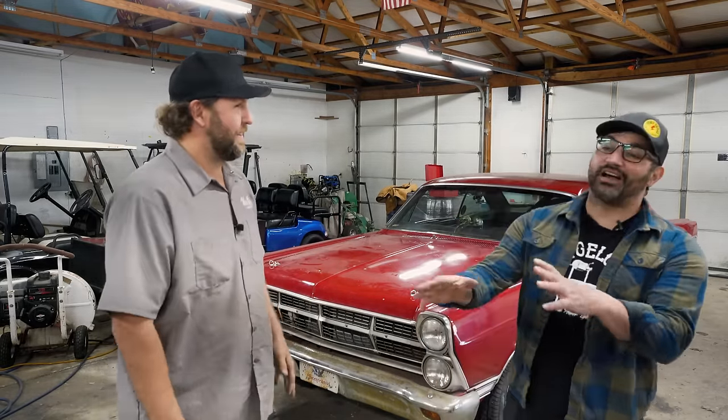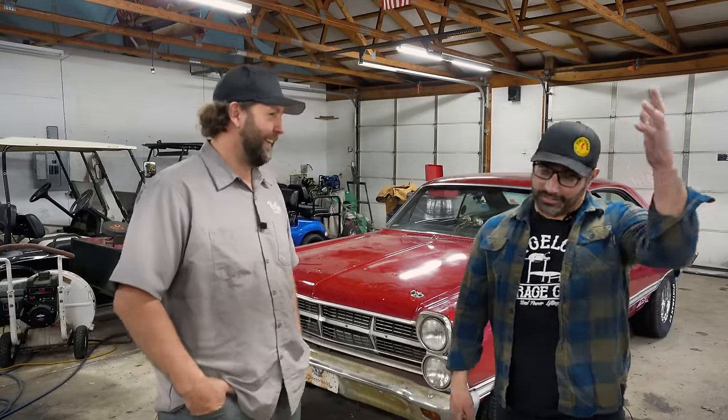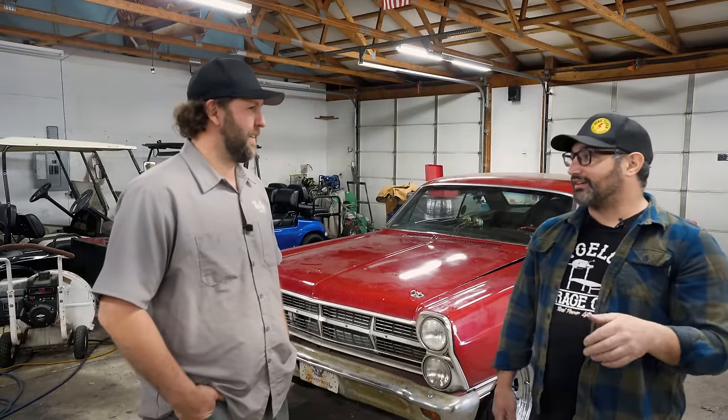Yeah, we tried to sneak it by as just a little stock motor we put a four barrel on top of, but we got a little bit more nasty than that. We did full 202 160 valve Summit aluminum heads, a 550 lift camshaft. I think it's the F303 setup. You know, Ford does the letters. So yeah, pretty rowdy. Big old four barrel on it, headers, everything.